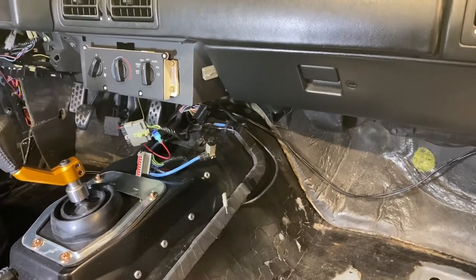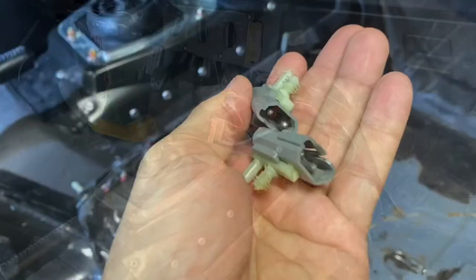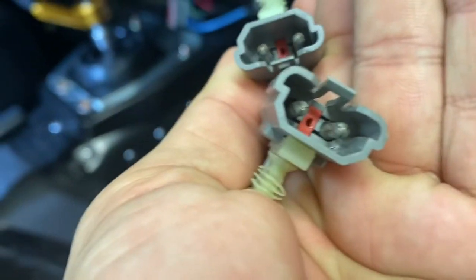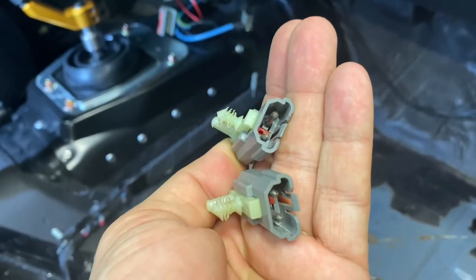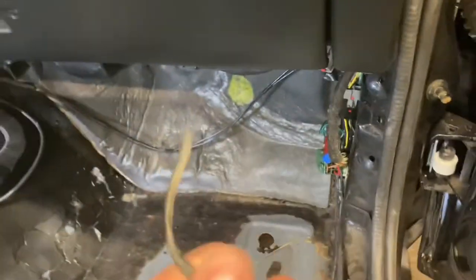Or you could do it another way if you prefer. If you need help finding a female plug for this, the 97 to 2000 F-150 power window motor plug is compatible. They're a bit expensive — Ford sells them new for about $20. It's a pretty common 80s and 90s plug, so you should be able to find one at a junkyard. This will plug directly into the speaker harness going to the door, and then you can tap those into your dash speakers.